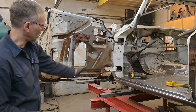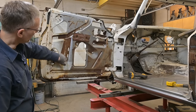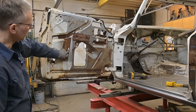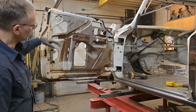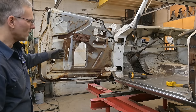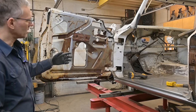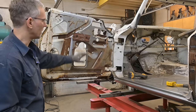You might think: why didn't I go through here? It's less to join up. Well, I want to retain this window stop when the window comes down. In this location it'll be more or less centered with the glass — it won't tip the glass when the window comes down. And we will have to, because of the nature of the mechanism, enlarge this hole a little bit bigger, create a flange, make it all pretty.